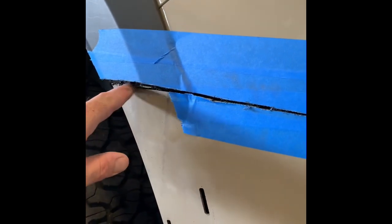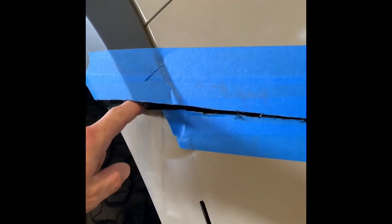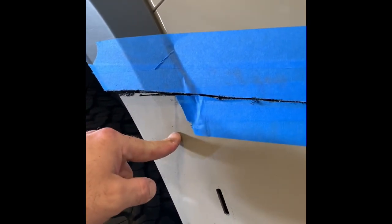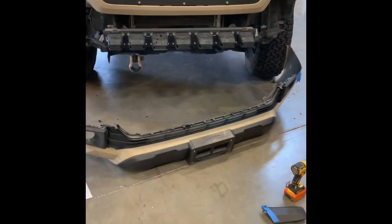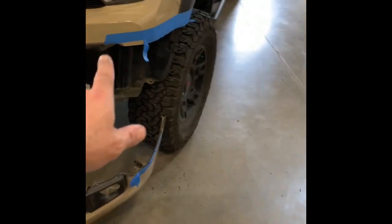The plunge cut method worked pretty well. When you're getting into the fender area, cut through just the layer of the fender and free it up. My cut got a little wonky there, but since it's on the piece that's dropping off, it's not a big deal. When in doubt, put extra cut into the drop piece and not the fender — it'll save the look of your fender and body lines.